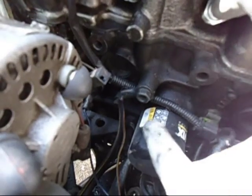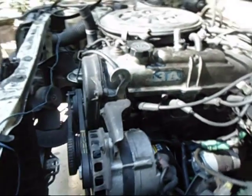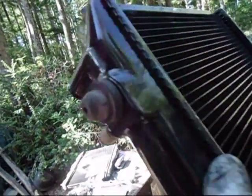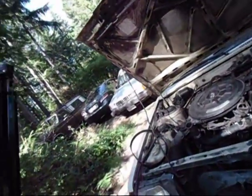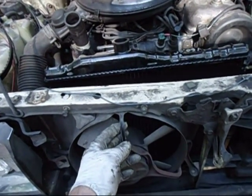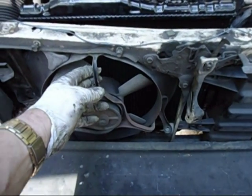Before you put the water in and the radiator, make sure you tighten up the drain plug on the block so the water doesn't leak out. I'm putting a new radiator in — don't forget to put the rubber bumpers on the bottom. I'm transferring over this copper-brass radiator; you can't really get them anymore. The aluminum ones go as low as 76 bucks, but the copper-brass was 166. As you set the radiator in, pull the fan shroud back away and drop it in without bumping the front of the radiator, then bolt it in and hook the plug back up.